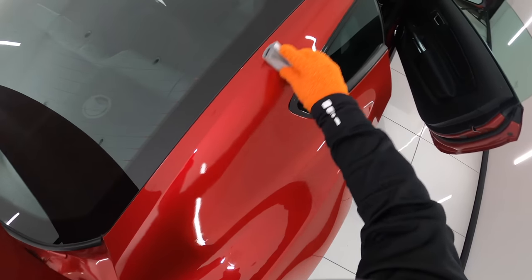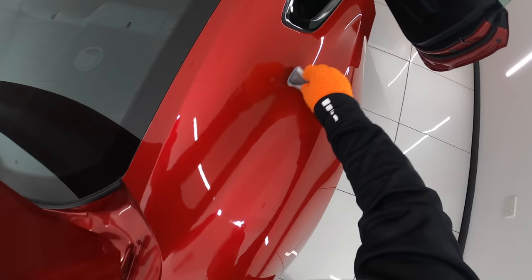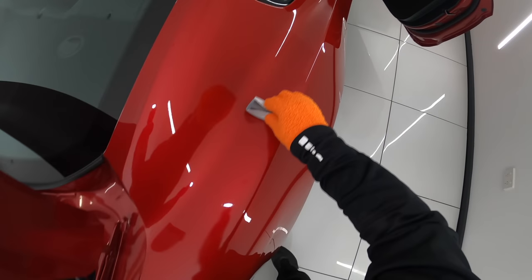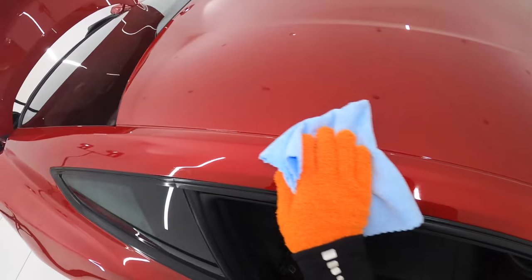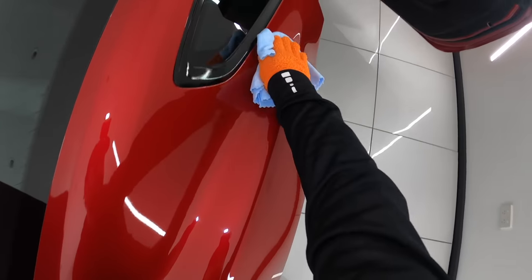Thirdly, lighting for applying a coating is also extremely important. If you're working outdoors, an overcast day is actually perfect for applying a coating, as it helps show high spots or streaks in the finish that you may otherwise miss because they're just so difficult to see in harsh or direct sunlight. But when working indoors, what you want to try and do is avoid harsh direct lights, as it also makes it difficult to see the coating or any potential high spots.